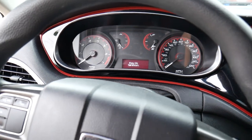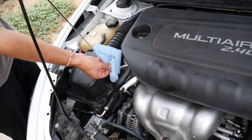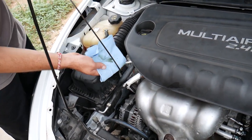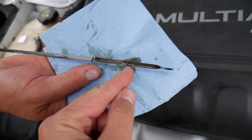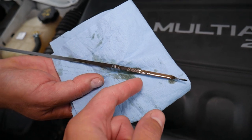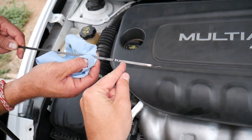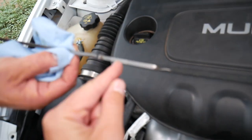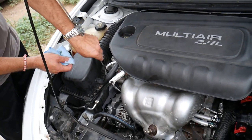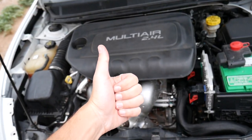Turn it off, wait about five minutes, then pull the dipstick again — wipe it, reinsert, and pull it again. Our oil level dropped almost to the minimum mark, so I recommend adding a little bit more and checking again. Bring it between the minimum and full marks, closer to the full mark, but never exceed the full mark — overfilling can severely damage your catalytic converter and other engine components. That's how you do the oil change on a Dodge Dart. Thanks for watching; please subscribe for more videos.